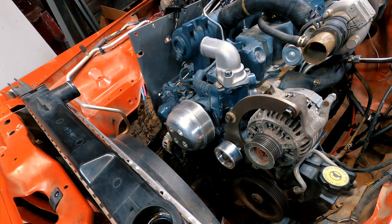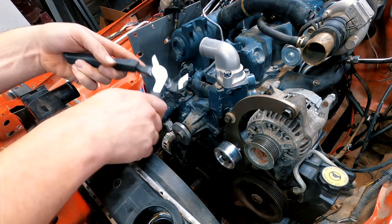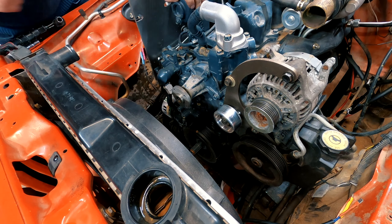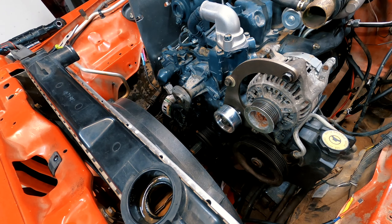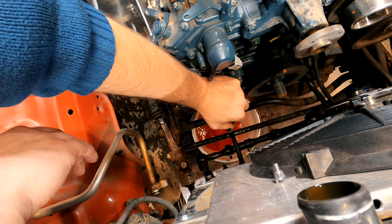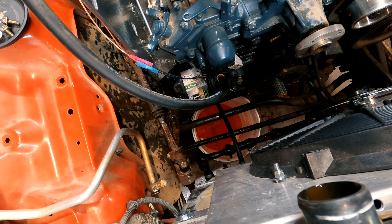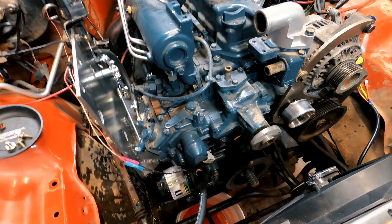I removed the pulley off of the water pump. Using a pair of pliers, I removed the hose on top of the thermostat housing. I did the same thing for the hose that goes from the water pump to the cooler on the oil filter. I then moved my drain bucket over to drain out the remainder of the coolant from the engine block. I did remove the hose just to check it for any cracks or leaks — if so I was going to replace it with a new hose.